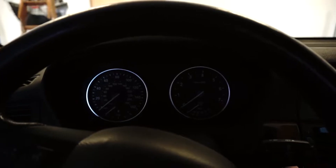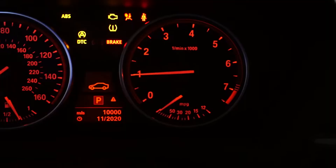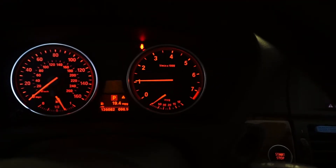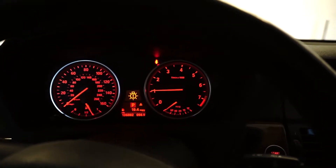This is the moment of truth and I'm a bit nervous, because if we have an air leak the RPM is going to be floating and it's going to be pretty rough — we'd notice it right away and definitely get a check engine light. Starting the engine now. I'm not 100% positive but usually with this type of issue we'd have rougher RPM jumps going up and down. Since the engine is cold we're going to get to the highway, drive it for 10 to 15 minutes, park for 20 minutes, then start it over. Let's get to the road.